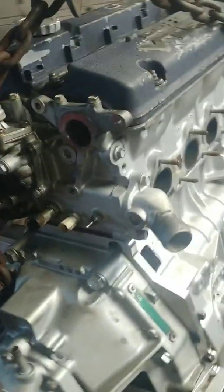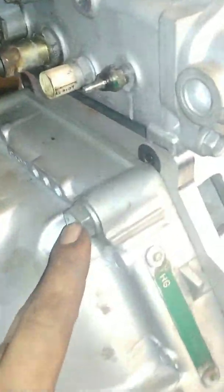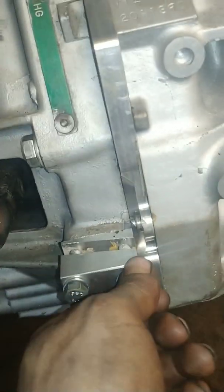Alright, so we got our plate on, we got our transmission, we got our clutch — our stage 4 comp with our flywheel — everything's torqued, spacked, loctited, and we got all our bolts proper size, because we can't go past the spacer, right? When we put our slave on we'll bolt this down, but yeah, it goes underneath.